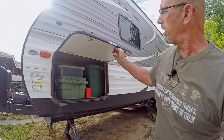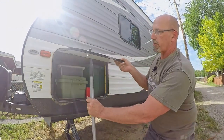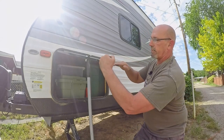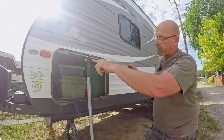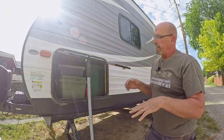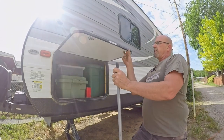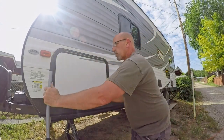When I drilled the extra holes, I used my third hand and got underneath the door and flexed it over straight — so it had a slight bow in — and then made my holes. When I put the rivets in, it's actually putting a little extra tension right there. And it looks a whole lot straighter, looks a lot better.